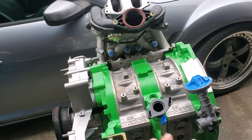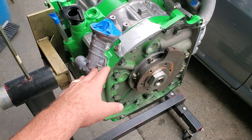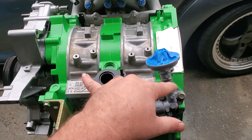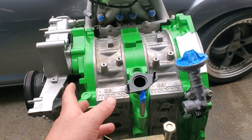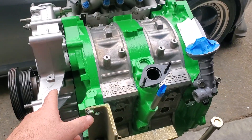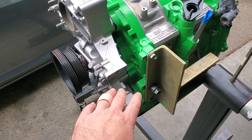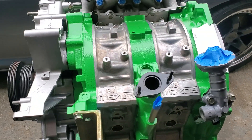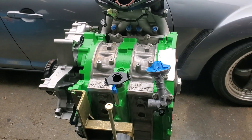The oil gallery passages have been polished. I don't go excessively large on any of the oil passages, but I do polish them out and match them to the gears. The gears have been matched to the housings. They're running Racing Beat three-window race bearings, WPC treated, and I modify those bearings to fit into the later model gears. The front oil pump gallery has also been mildly ported to allow the best flow around what the factory leaves as sharp edges, turning them into a flowing radius.